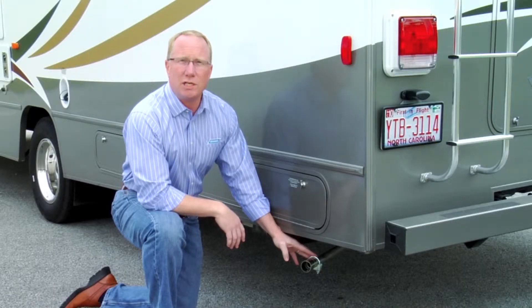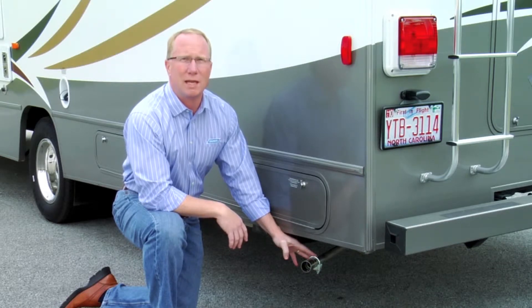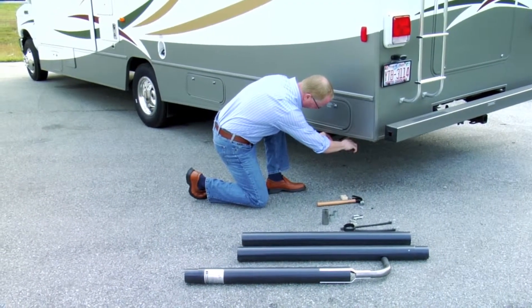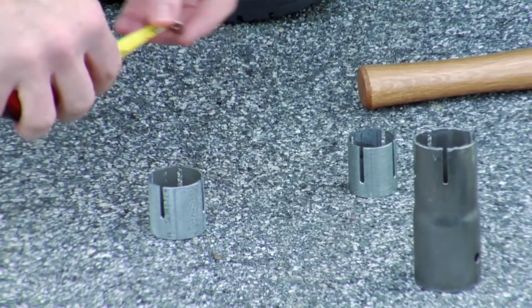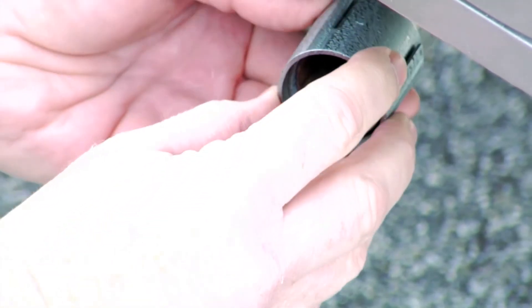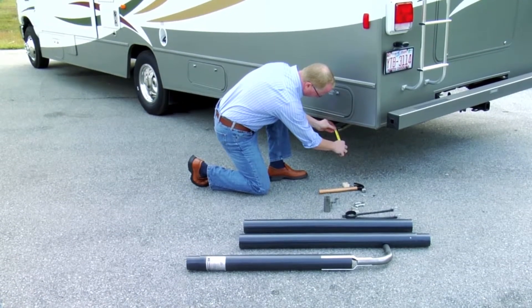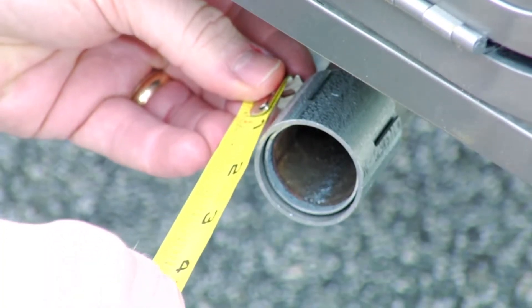In this step, the Genturi mounting adapter with the cross hole will be permanently attached and positioned for future mounting of the Genturi tube section. Measure the outside diameter of the exhaust pipe. Determine which adapters you will need to install. Slide the slotted end of the mounting adapter over the exhaust pipe, allowing 2 inches of exhaust pipe to slide inside the adapter. It is easiest to mark the exhaust pipe to verify the 2-inch insertion.